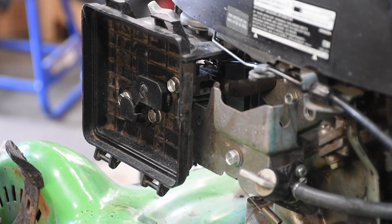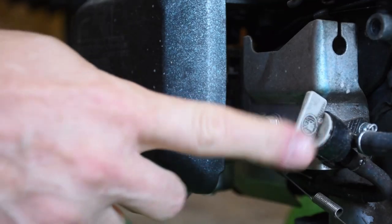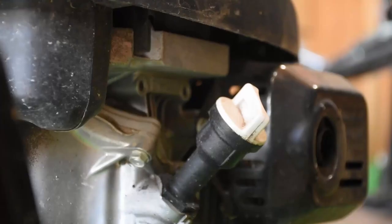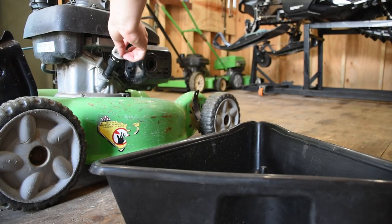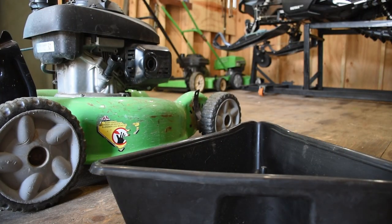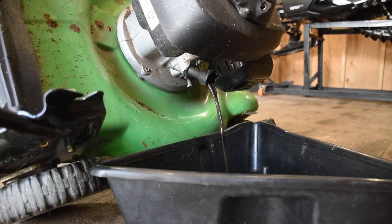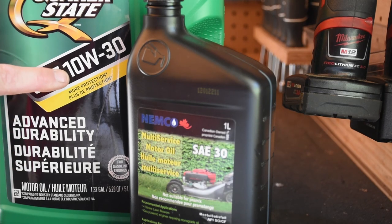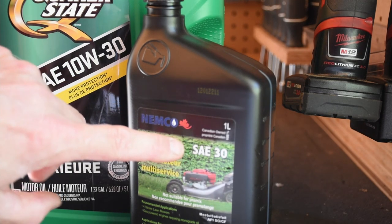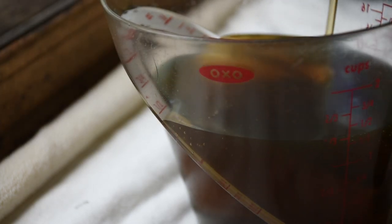I'm anxious to get this thing off the bench and see if it runs any better. But before we fire this up and hand it back to Brian, I think we better change the oil and sharpen the blade. Let's start by turning off the fuel again. These Honda mowers are interesting in that you actually drain the oil out the fill tube, unlike a Tecumseh or a Briggs which has a drain bolt underneath. So we start by taking out the dipstick and setting it aside, then basically tip it over onto its right wheels and the oil comes right out through the fill tube. For new oil, Honda recommends 10W-30 — if you have a Briggs or a Tecumseh you may want to use SAE 30, just check your manual. We're going to add 12 ounces of fresh 10W-30 to this machine.